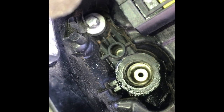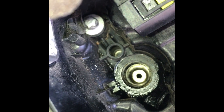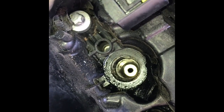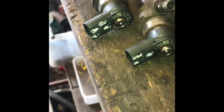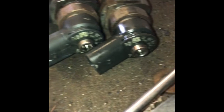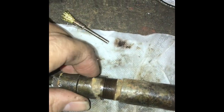It's important before you take the injectors out to mark them up. Luckily these were already marked up, so maybe they'd been out before and these are pretty recent ones. So what we're going to do now is split the injectors and give them a good clean up. We borrowed somebody's workshop on the yard - thank you very much. So as you can see, that's injector 4, injector 3, injector 2, and obviously injector 1.